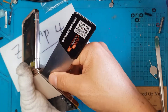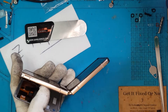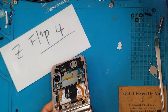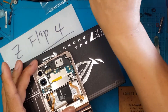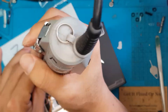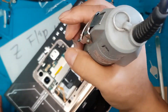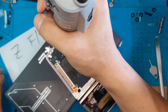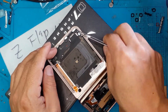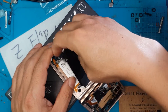We'll try to be more careful here. The back portion is actually in pretty good condition. We have a connector going to the main board, so we'll remove that so we can remove the cover. We'll use this cardboard box to prop up the device since it doesn't want to lay flat. Now we're gonna remove the screws holding on the covers for each part — this is the bottom part.